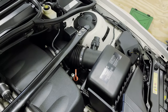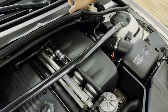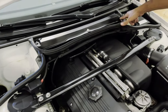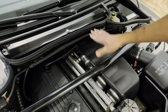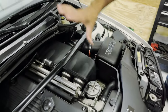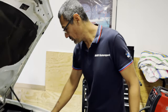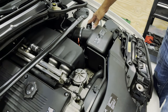We're going to go ahead and get going on the breakdown. First, I'm going to remove the strut tower bar, remove the air filter and the cabin air filter. This section here has just got four Torx bit screws back there. Remove the power cable and stuff, disconnect this, and then we'll pick up from there. These should be very simple and easy. Once we get those items done, I'll start taking the intake and disconnecting the airflow.